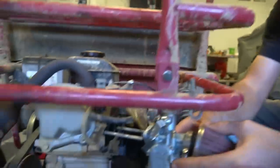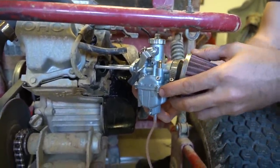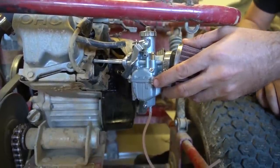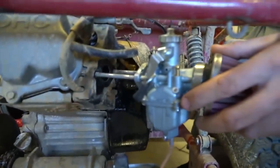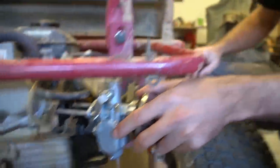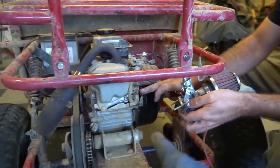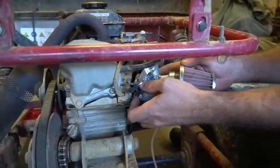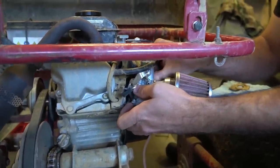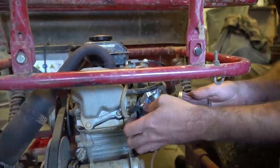Yes, definitely. In terms of horsepower, it should be fine. In fact, we'll probably pick up some horsepower, if it'll work. Man, the holes are so close. If we take these studs out and just get some short bolts, it might just bolt right up. All right. Yeah, I'm totally down to do that, man. So we found some hardware that's going to work with this Subaru head. Of course, your Mikuni kit will come with proper hardware for a Predator 212, but we had to scramble some stuff up for ourselves for this Subaru.